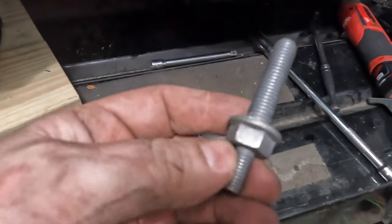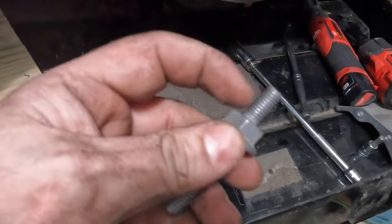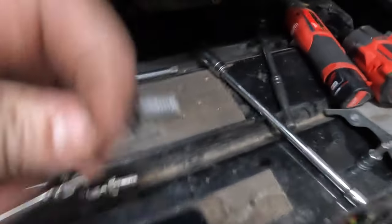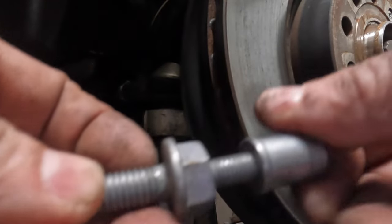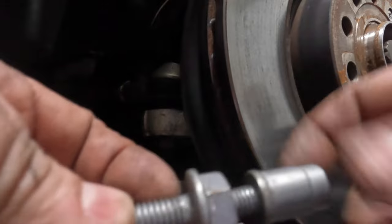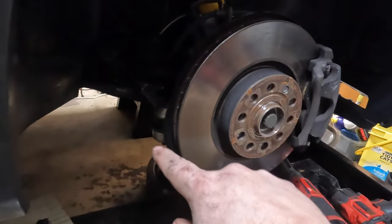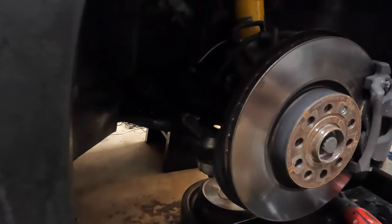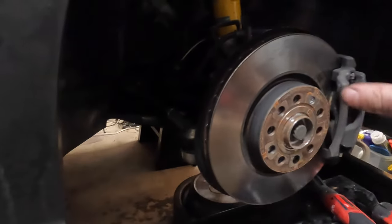Alright, and this is what that fastener on the side of the heat shield looks like. It's one of these compound fasteners. Bolt goes in, and this piece right here goes, that you pull out with an 8mm Allen. So now that we're done with those three bolts, they're the ones that we need this whole side removed for. And we won't need to mess with this again until we are at the final parts of the reinstallation phase.